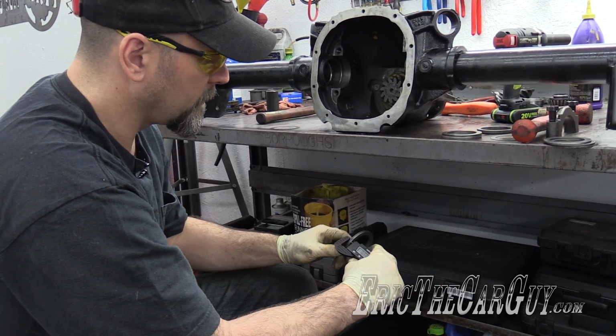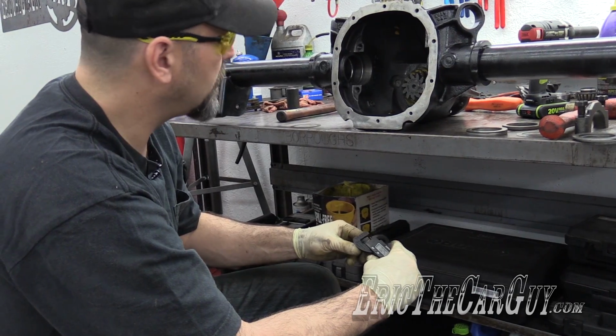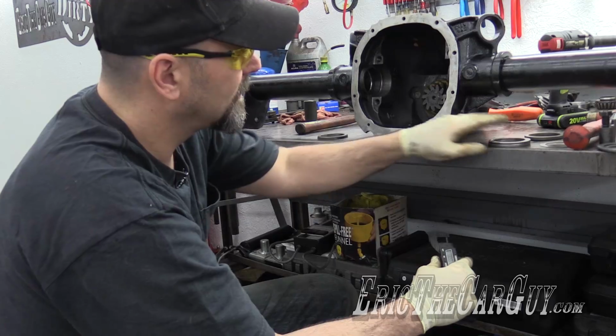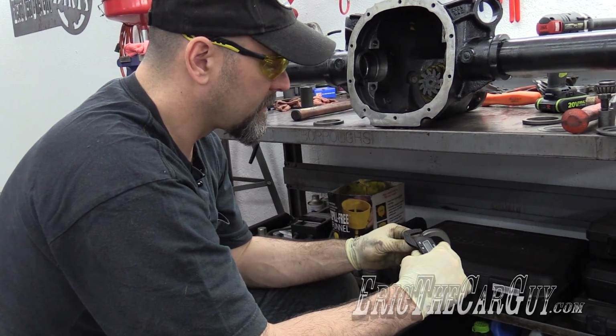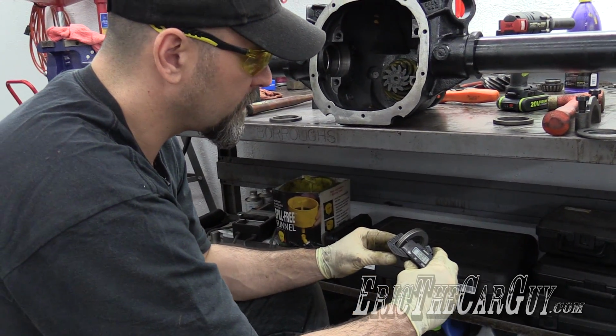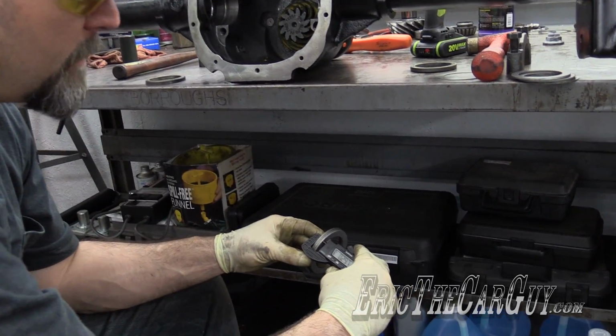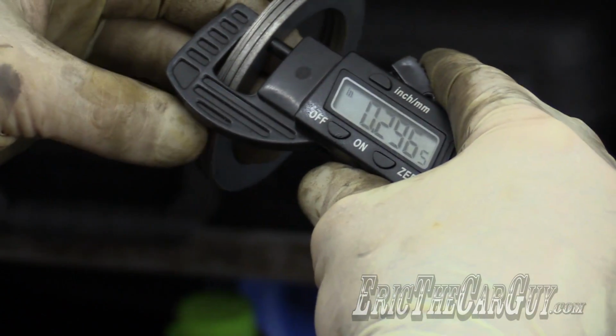And we're going from 251 to 272 over on this side. It seems like it's going to be tight, if I'm honest. I almost want to remove one more shim from this side. Oh, for some reason this comes up 300 now. And because I'm stacking them like this, it's difficult to get an accurate reading.